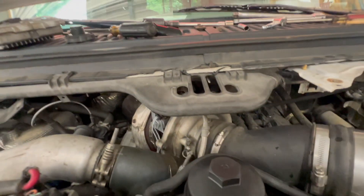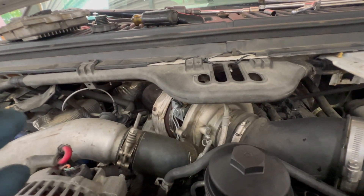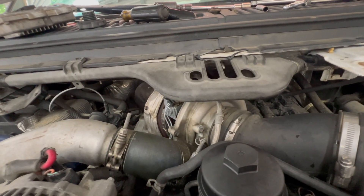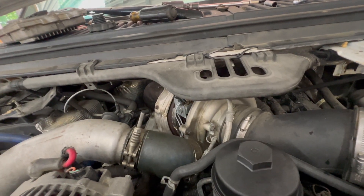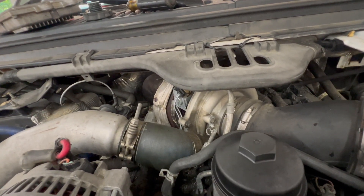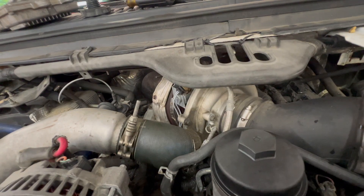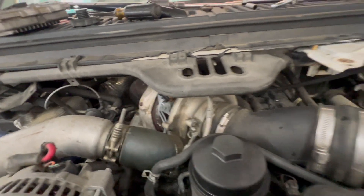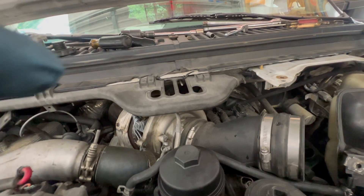I don't really think we have a high pressure oil leak. When you do an air test, it's normal to have slight air leaks at your upper injector O-rings, just because they're meant to seal oil pressure and none of them ever usually seal up 100%. So this is kind of re-emphasizing my thought on the IPR being at 70.